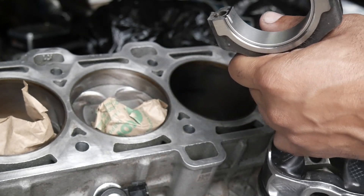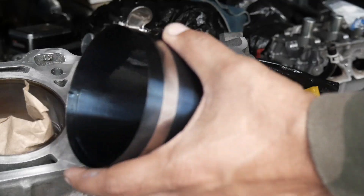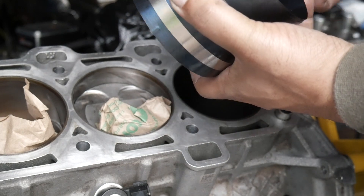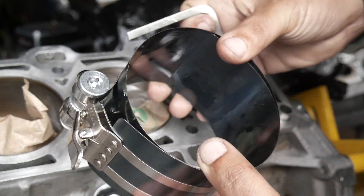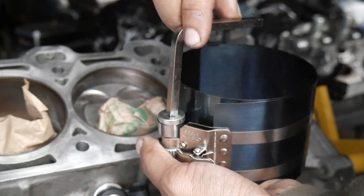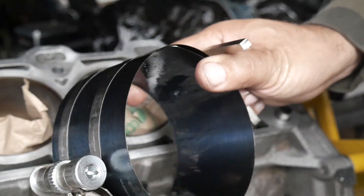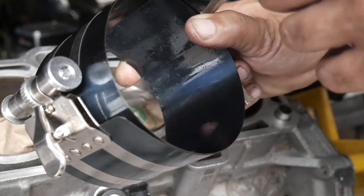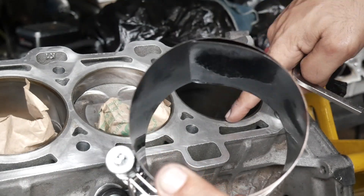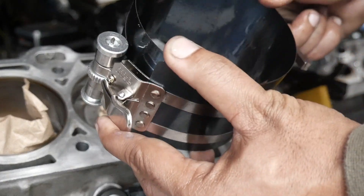It's in there. Before we start dropping it down into the engine though, I'm going to go ahead and put some assembly lube on it — probably a lot more on there than what I need. Now when it comes to putting the actual pistons themselves in, you're going to need something to help compress the rings and get them in here. This is a little tool Gabby and I went to AutoZone and picked up — it costs like 10 bucks to rent. It'll fit any size for the most part, it's got a little Allen key in here to help you adjust the size and it's got a metal band that goes around it to help you bring these in. It does work — I got every other piston in here using this — but it's not the best. This thing can slide around and move. I've had problems when it gets down near the actual cylinder walls where one would slip out from the bottom, so you have to make sure you have it really pressed up against there.